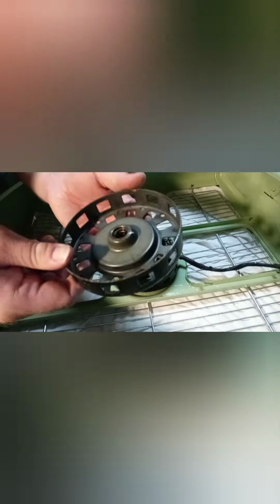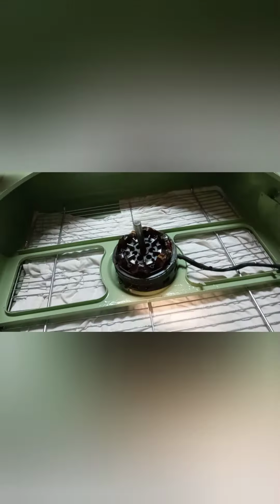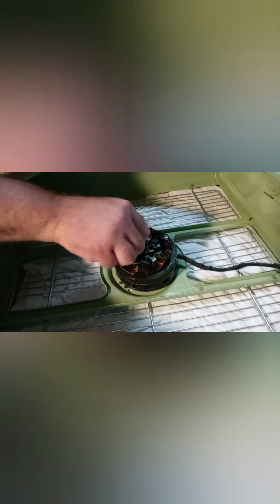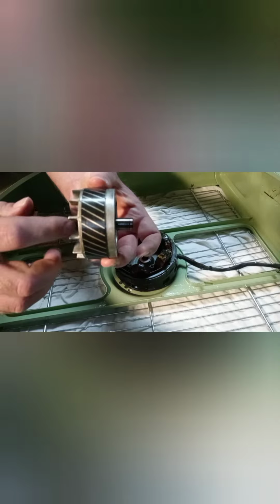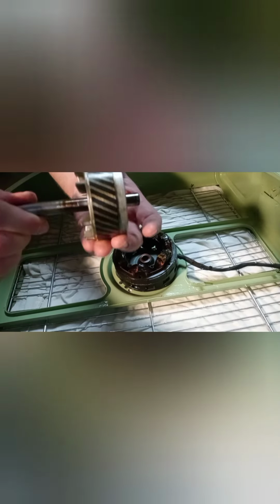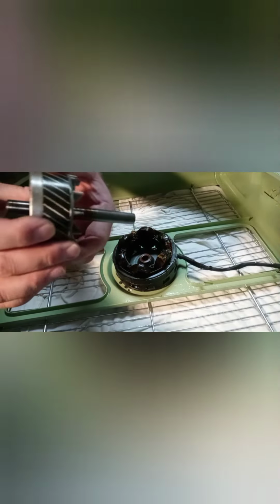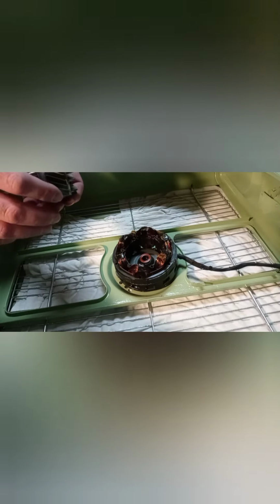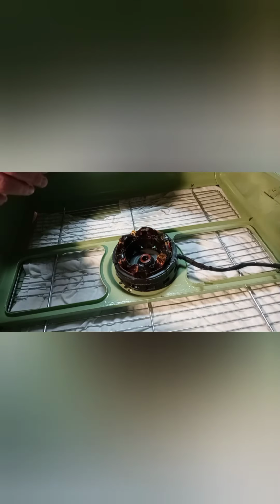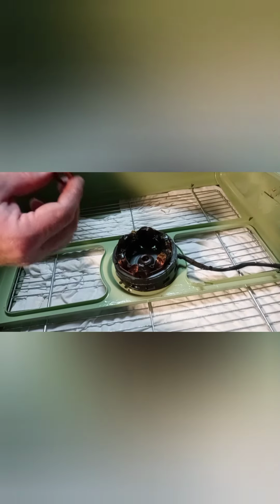These are basically press fits, so I'm not exactly sure if these could actually be removed. Okay, here is the rotor shaft. Take that out. Yep. You look there on the side, it does show signs of scoring and whatnot. It's a little smudge, and that's not healthy on these bearings. I wasn't using the right kind of oil for this motor, and I think that's the reason it was starting to slop up a bit more like this. Some little fiber washers to it.